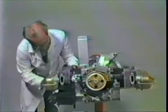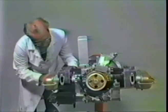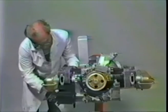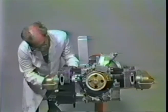Now, of course, if you're doing an overhaul and you have a bad stud, either one that's rusted off or broken off or whatever, the machine shop is the right place to have that replaced. You can try the double nut technique to get it out, but sometimes that won't do anything. At the machine shop, they can take and weld a nut onto the stud, let it cool, and then with a wrench you can back that stud out, I guarantee you. And occasionally we have to do that with studs.